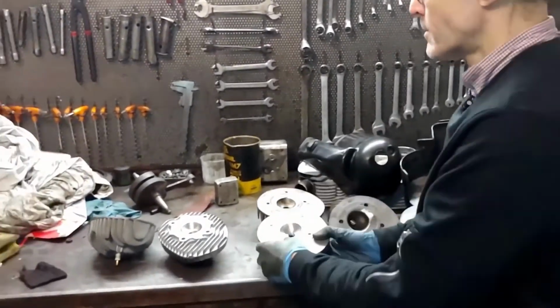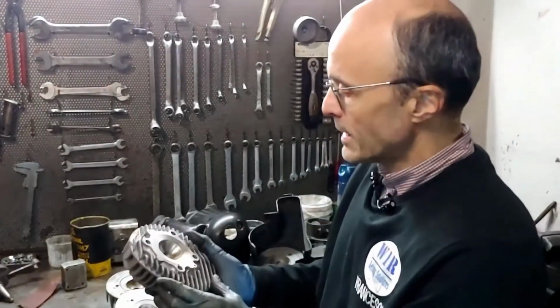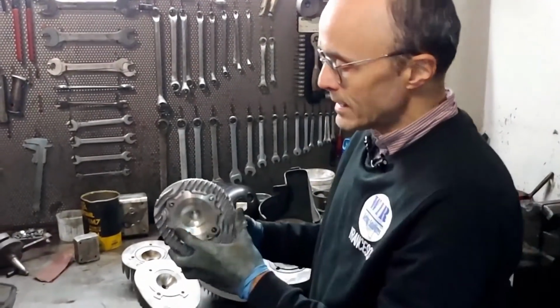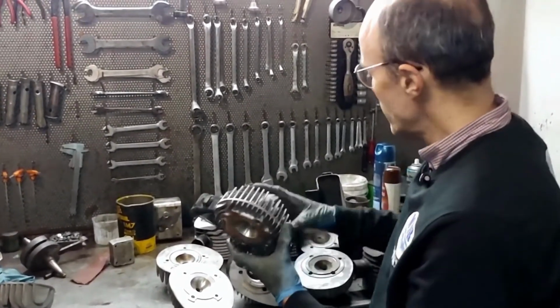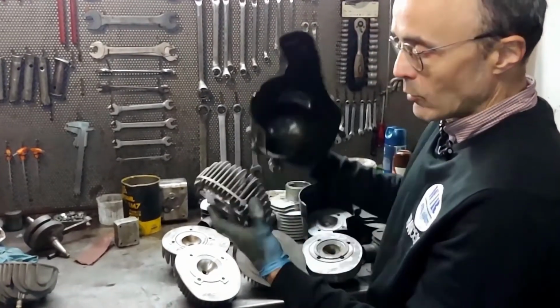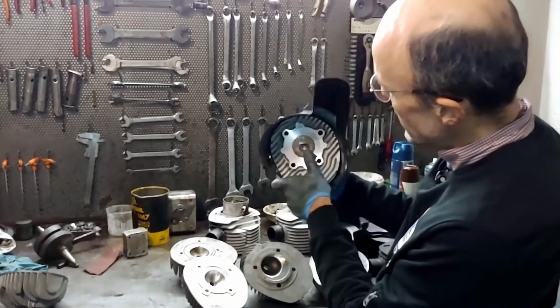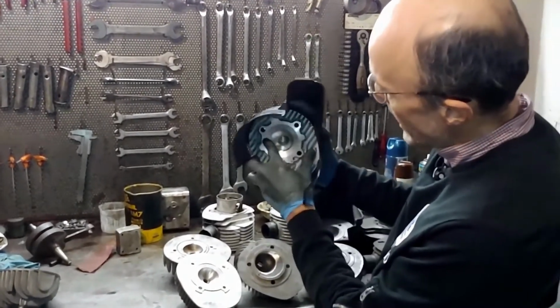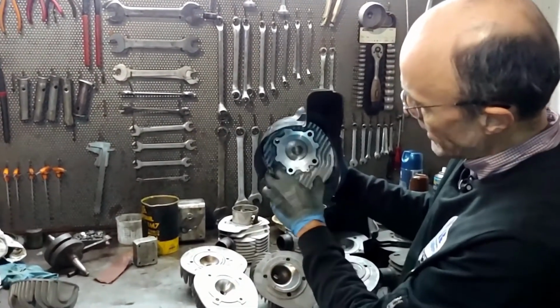Pay attention to them if they happen to you. So we said, this is the Malossi head, and then there was this excursus. And this is the Pollini head, which has the great advantage of having this lower fin, which contributes not a little, especially with the standard bonnet, and with the fin above left as it is, because the passage above is what it is, but in any case, the air can also touch the lower part.